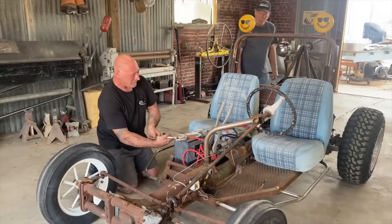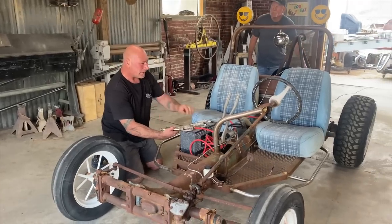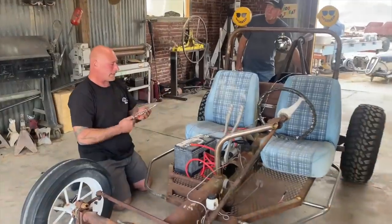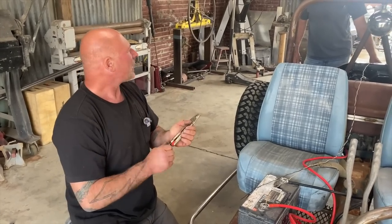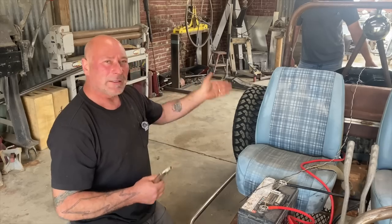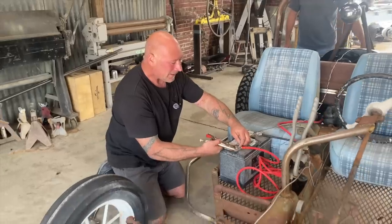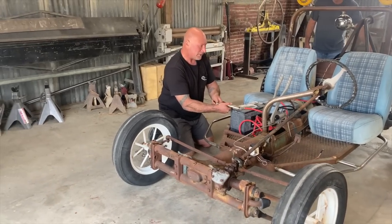It's got to clear itself — I know these Volkswagens. When you use an earlier model transaxle with a later model VW engine, you have to do some grinding for the flywheel because it's a bigger one — it's like 180 to 200. So this was clearanced, but there's a lot of debris in there that's what you're hearing. It's gonna clear out. This is our high-tech ignition.